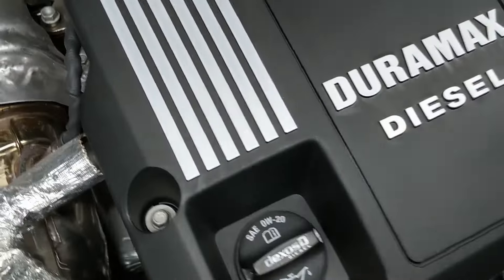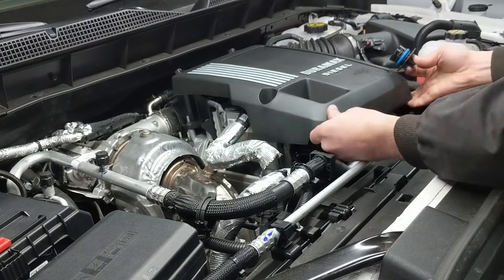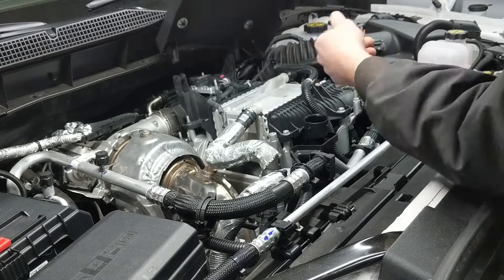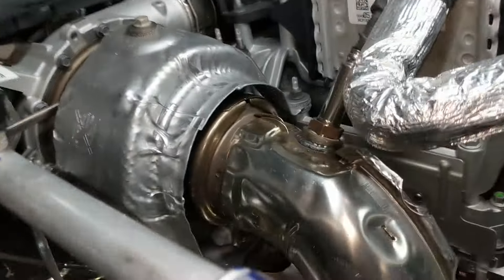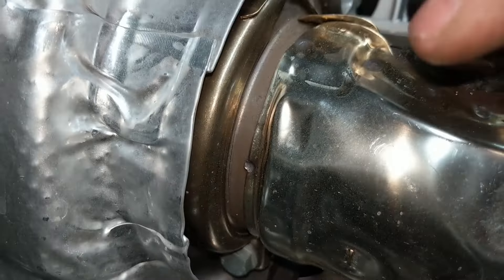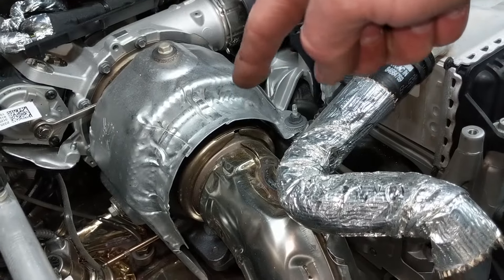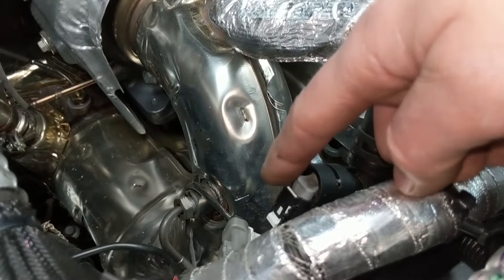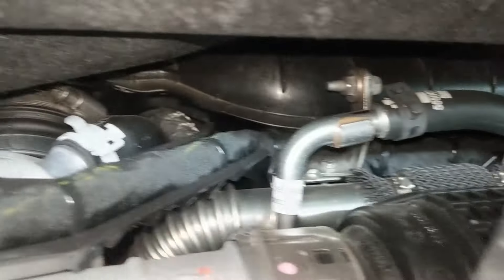Looking back at the engine, we're going to take out this bolt with a 10-millimeter socket, take off the oil fill plug, and then we get a look at the intercooler. You can also see the turbo and the DEF injector. All the exhaust routes out the exhaust manifold and goes through the turbo — that expanding flowing exhaust spins a turbine wheel, and then the exhaust departs and travels down through the various catalytic converters for emissions.